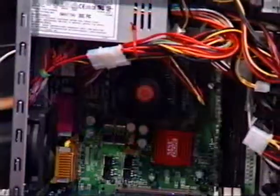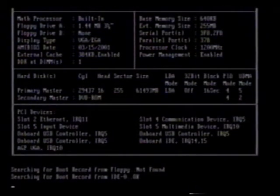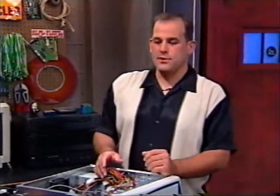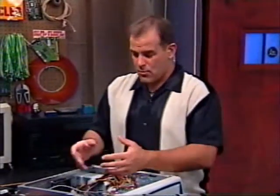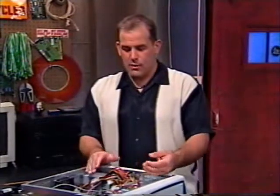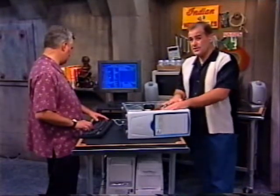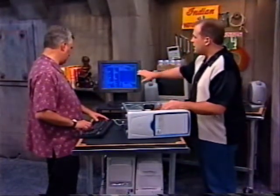The fans are on — that's great. All fans are on. We've got a boot-up message on the screen. We got the BIOS. Now we're going to go into the BIOS, so we should explain what the BIOS is. It's the basic input-output system. It lives in the chipset inside the motherboard and controls all the basic functions of the PC. When you hit that power switch, the chipset wakes up and looks around — it checks for a graphics card, hard drive, memory, processor. It goes through its own checklist, then goes to your hard drive to look for the operating system. If you don't have an operating system installed yet, it'll just report that it hasn't found one.